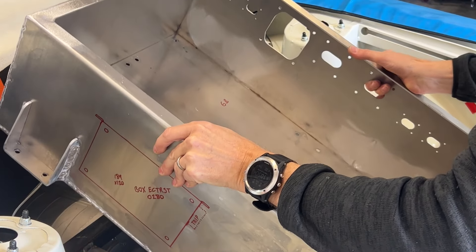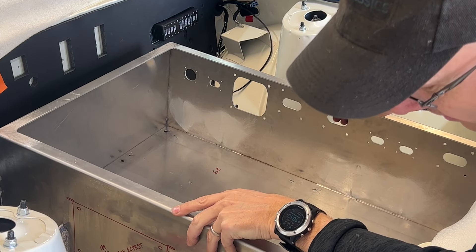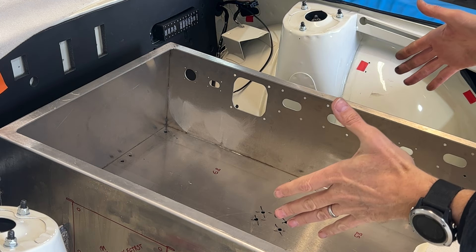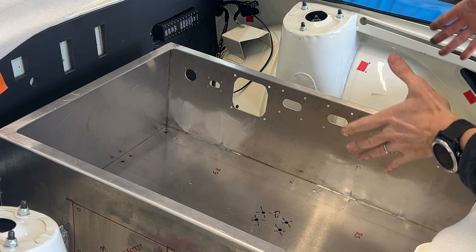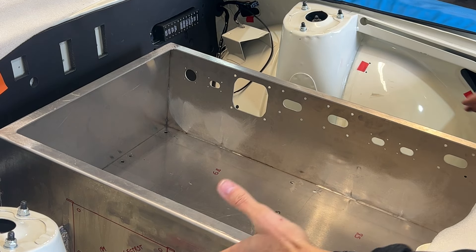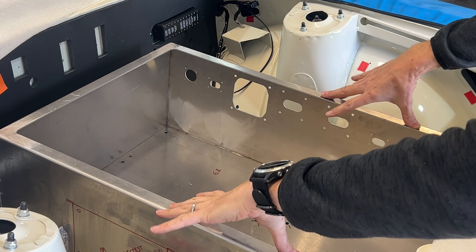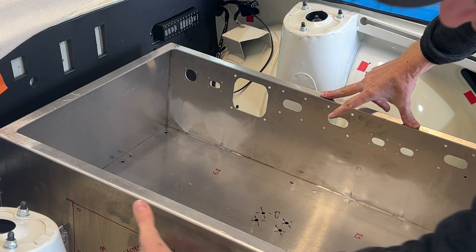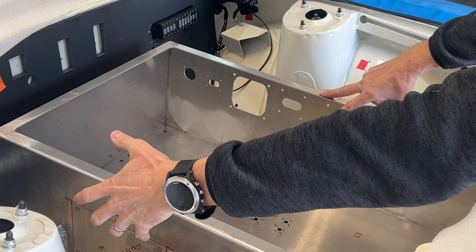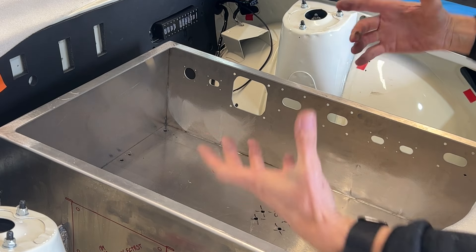Here's the battery box — a little lighter than it will be once it's got all the battery modules in it. You can see it sits in there and fills up the space. We've pushed it slightly to the right in the car to clear the steering column, which has also given us space to fit the 12-volt battery. We're mounting as much as we can onto the battery itself — the 12-volt battery, the fuse box, and the controller are all sited in the battery because it just makes it easier.